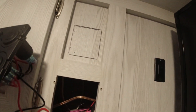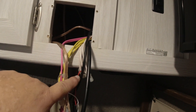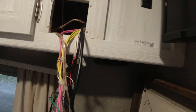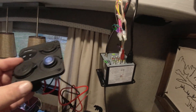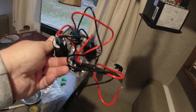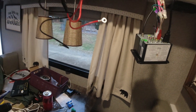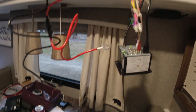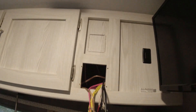We've taken the radio out, and we're going to put the new unit right up in here. We've measured it — it's a little smaller than our area — so we're going to cut that area out and run our wires through. We have a red and a white wire going into the stereo, so we're going to break loose those connectors and probably use wire nuts. The nice thing about this setup is it already has the wires made up. You just follow the instructions, plug them where you need to, and you have two wires coming out — a black and a red. Red is your hot positive, black is your negative.